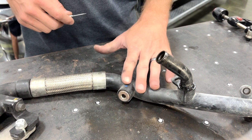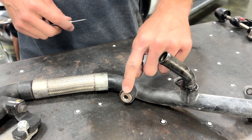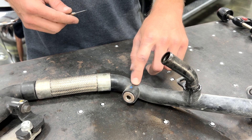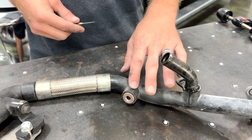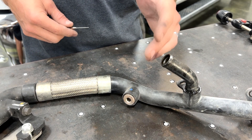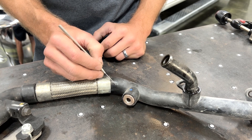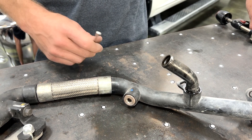You need to refer to your instructions for the exact place to cut because this tube varies by every generation Ram truck. This is a 2016 model year. This boss is where your coolant returns from the factory charger. Since it's a race vehicle, he's already upgraded to a bigger fixed-geometry turbo and doesn't need that, but I'm going to keep this in case he ever goes back to a VGT charger. If you have a VGT charger you need to keep this boss as well. So I'm going to basically cut this bend of the pipe off.